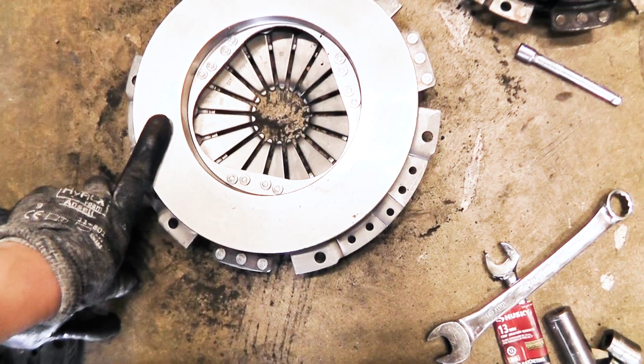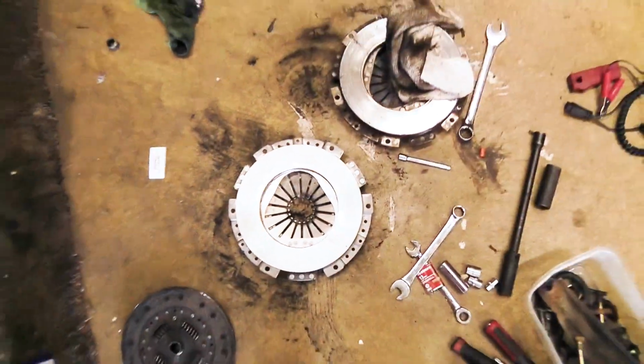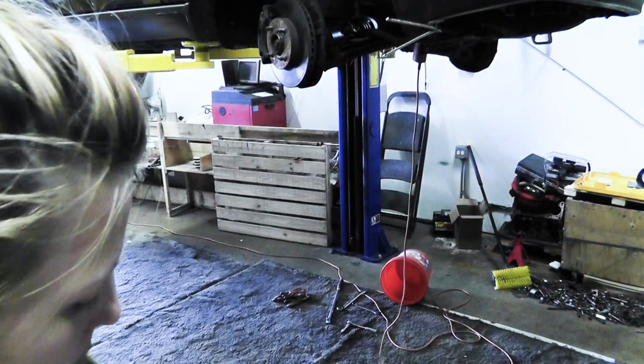Right, so the groove in there and the flat part need to be degreased, because just like in the brakes, nothing can be greasy here. It needs to not slide, and in factories they coat stuff with some kind of grease a little bit so it doesn't rust wherever it sits in the warehouse. So take something to degrease those.